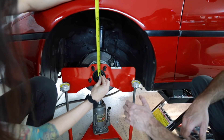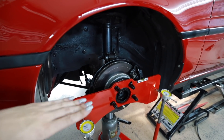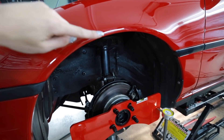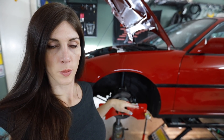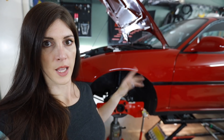13 and a half — that's static ride height right there. We can zero these out. 13 and a half inches is exactly static ride height when the car is just sitting on level ground, measured from the center of the hub all the way up to the lower edge of the fender well. Zeroed out — dead center, 13 and a half inches. I'm going to compress the suspension one inch to 12 and a half, take readings, then back down to 14 and a half, take readings, and then hit bump stop.